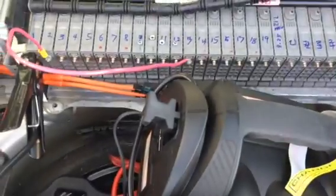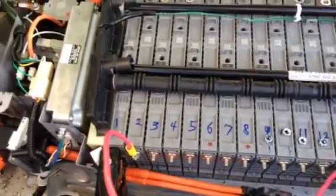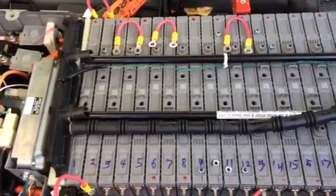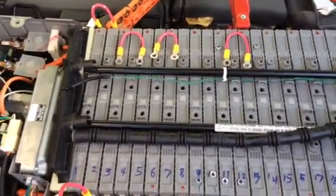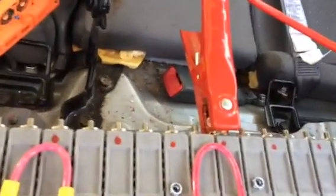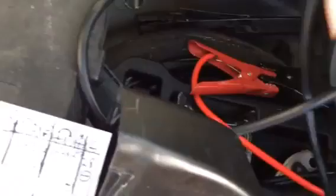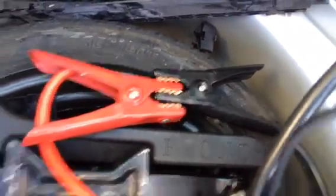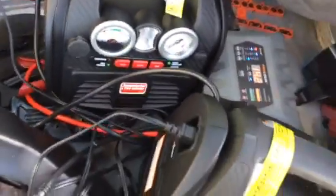Except there's one left over — 3 times 9 is 27. So I chose the weakest battery; the last one left was number 13. I tied it in with numbers 1 and 2 and finished charging that group at 24 volts. So that series of numbers 1, 2, and 13 is synchronized to make one 24-volt battery. There's the positive side hooked to number 13 and the negative side hooked to number 1, and the two clamps together made a 24-volt charger.